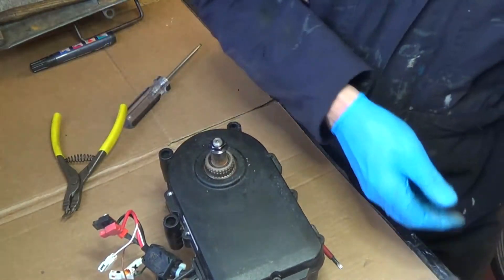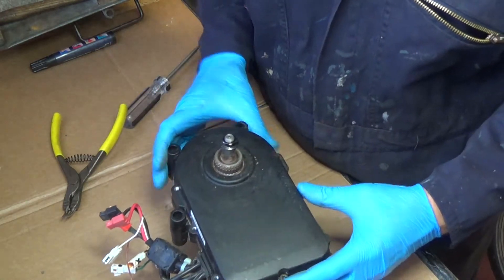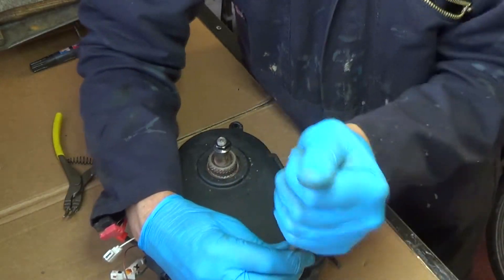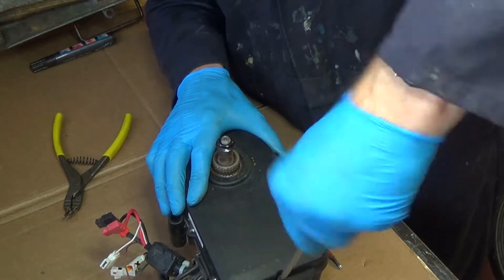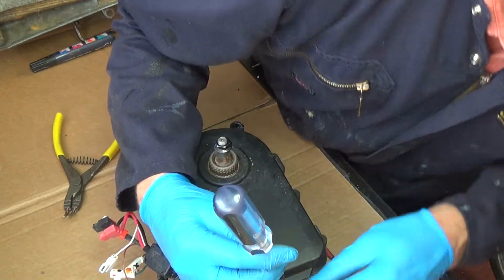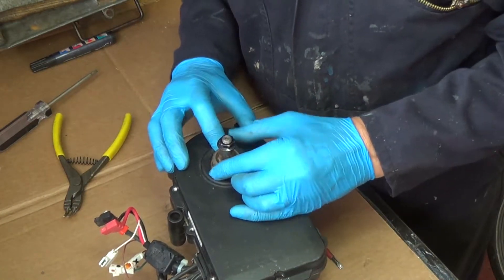The problem I've had is that first of all it was just making a bit of a shushy noise as I was cycling along. I thought maybe it was a worn chain, replaced the chain — still no change. Then it started doing this banging, clacking, crunching, jumping thing which I've heard about before in Kalkoffs. So that's why I thought I'd try and see if maybe it is a bearing — and there is a bearing there.